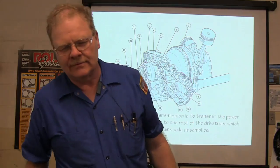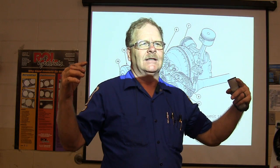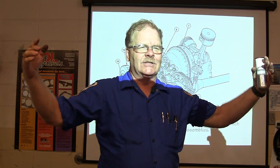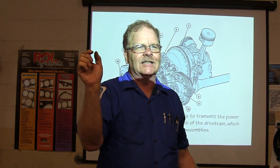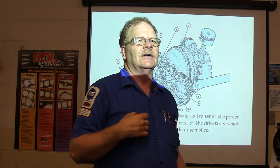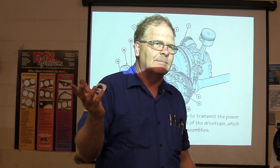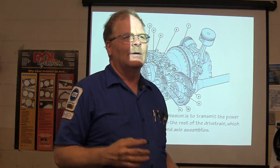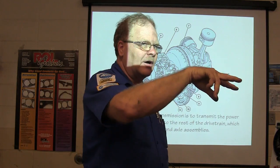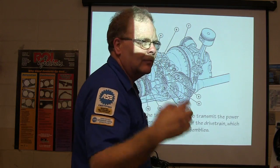He was working on the one that you guys are having to do where you have to take the axles, push them in, let the C-clips fall off. He's working on a late model Chevrolet and it's positive traction. The bearings on the outside were shot, and he's trying to push the axles in, and he could only about half expose the C-clip. It wouldn't go in. And he was trying to figure out if he was missing something. I said, get a big hammer and hit the axle and knock it in anyway, if he's replacing the bearing and it may be fouled out there or something. And when he did that, his C-clips dropped out. Y'all know what I'm talking about when you pull the grill out. We did it on your Mazda last semester. You remember that? Lifting the axle.